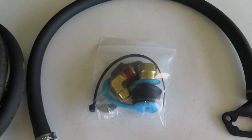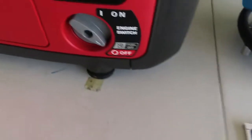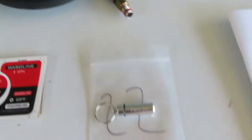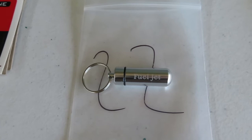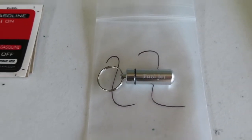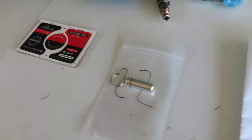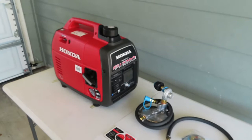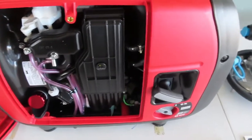There are a few other fittings to install. It's got a sticker to replace the choke knob so you know where to turn it when you want to run on propane. It comes with a little keychain container — it says it's got a jet for natural gas, so if you want to run on natural gas it requires re-jetting. I'm going to try natural gas without the jet and see what happens. Anyway, I'm going to get going on this conversion.